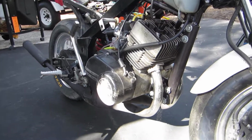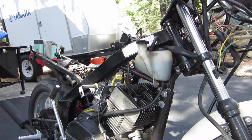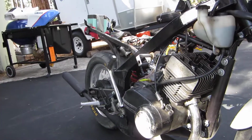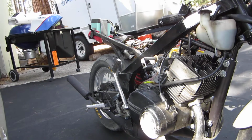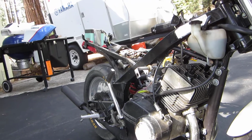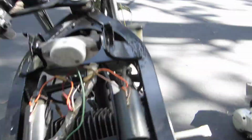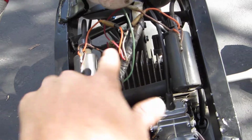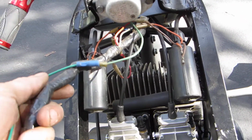The original bike is also oil injected, so I could use the stock oil tank and just hooked it up to the RD125. I'm running oil injection and just tuning for gas, rich or lean. A couple little things I did as well for mounting: I had to weld 2 brackets on each side to hold the coils on each side, but there's plenty of room in there.